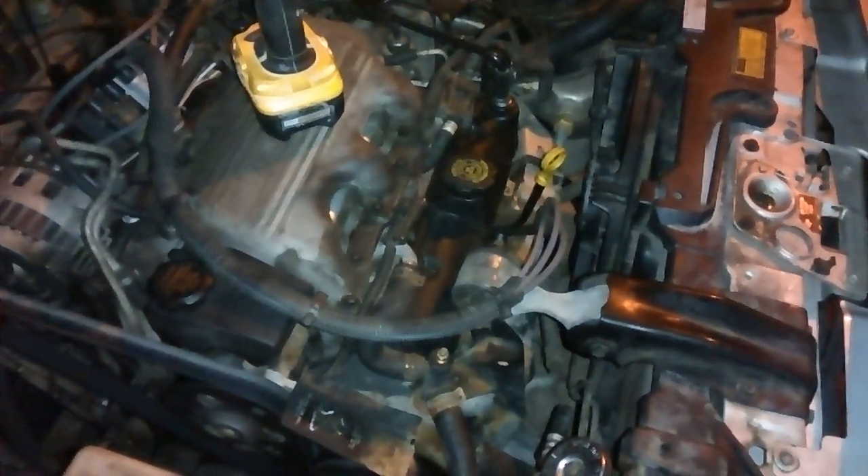I have a feeling we're going to see a lot of difference. The biggest difference though — you see that 'made in China' on here? Well, the one I put on first says 'made in USA.' Not all coil packs are created equally, and certainly not all plug wires are created equally. I'll show you how to test plug wires later — you can test them for ohms. I recommend taking an ohm meter to the parts store when you go to pick up plug wires. You could save yourself a lot of hassle that way.